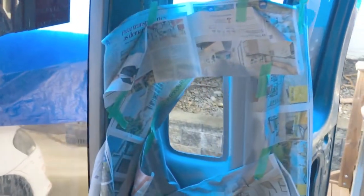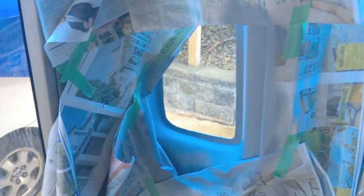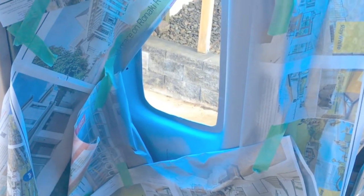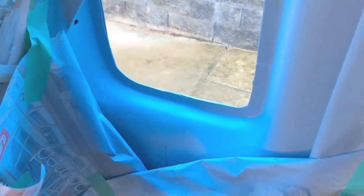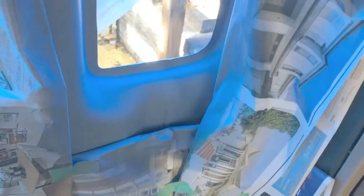Maybe a few days since I've looked at these windows, but I've done all the prep work on fixing the holes and now it's been undercoated. There were holes along this edge and I roughly filled it with a fiberglass type builder's bog or auto bog, then sanded it back and used some finer filler to finish off and gave it a light sand. None of this is probably going to be seen so it doesn't have to be super pretty, but the rust is gone. This has all been rebuilt to about the right size for the seal when we put the window back in, and I've resprayed it. The other side was the main area of concern — there were some bigger holes and quite a bit of rust, but I'm pretty happy with how it's looking.